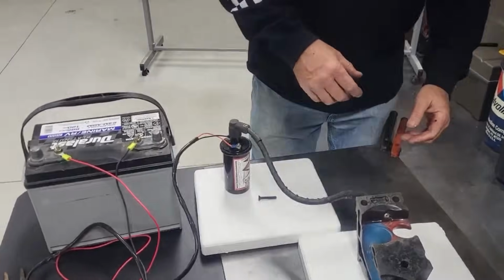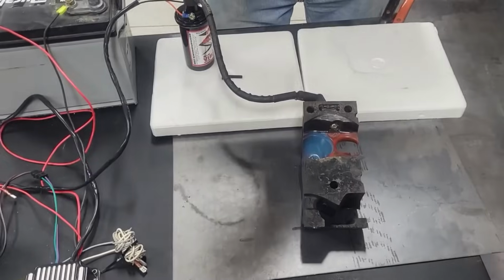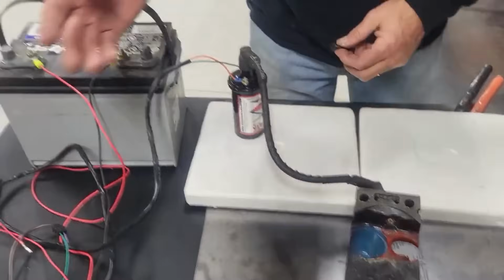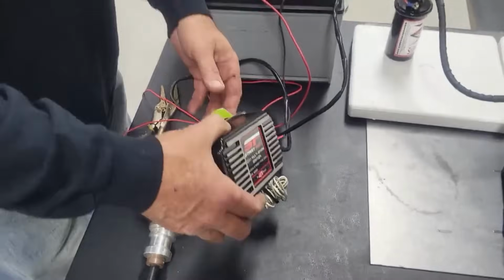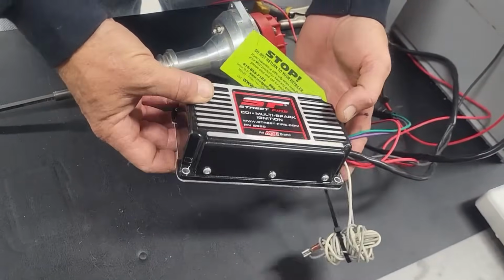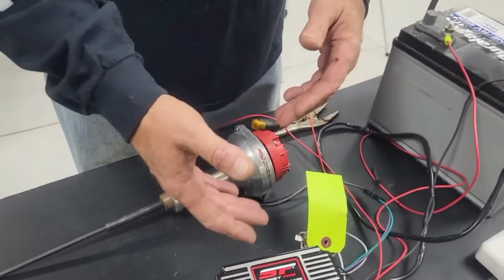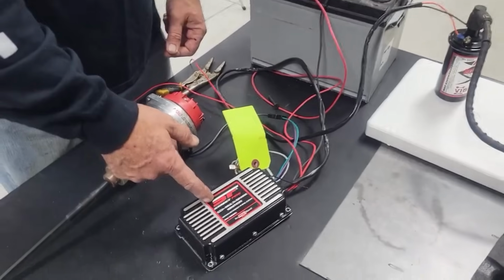All right, now, first thing I'm going to do is show you what a properly grounded engine should do. Here we have a cylinder head simulation that I've cut in half, and a spark plug in there. We've got a coil, and we're using MSD here. By the way, let me give you a little safety here. MSD makes multiple types of boxes. This is just a Street Fire box. It's about 5 amps or so, and I did a test on it. When you're running the car with no alternator and just on the battery, you're losing 0.5 volt draw, I think it was, from just the box.